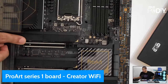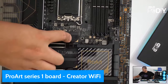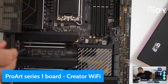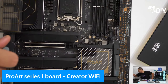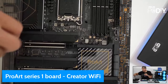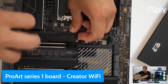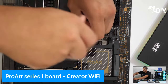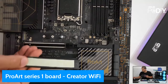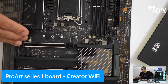Now, for the M.2 based SSDs, again, you have M.2_1, M.2_2, M.2_3, M.2_4. These do not have the dual contact design. So again, if you want the dual contact design, you're going to want to be looking at the ROG Strix, or you want to take a look at the ROG Maximus series based motherboards for that. I'm just going to go ahead and remove this just for reference so you can see. But these do all still maintain that nice Q-Release design, right? So you can easily install the M.2 based SSD, and you also have your thermal pad right there to make sure that you're getting the heat dissipation.